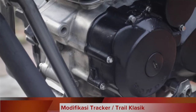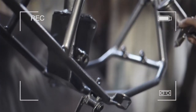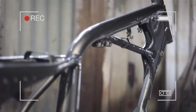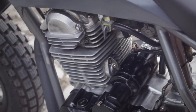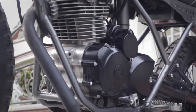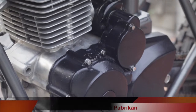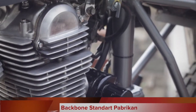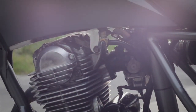The most fundamental modification was to the frame and chassis. The rear frame section was completely cut off, and underneath the engine we made a double-branch structure to make it look more sturdy and protect the engine from below. For the center frame or backbone, I still rely on the stock one, as I think it's already good enough and strong enough to support the engine load.